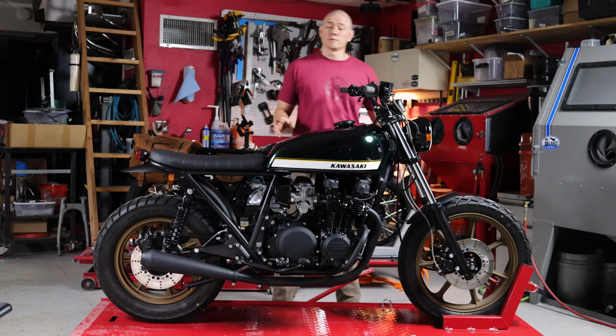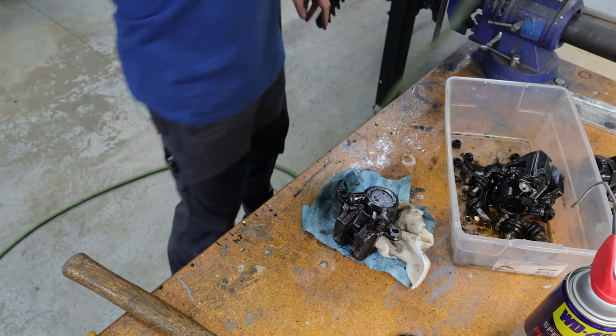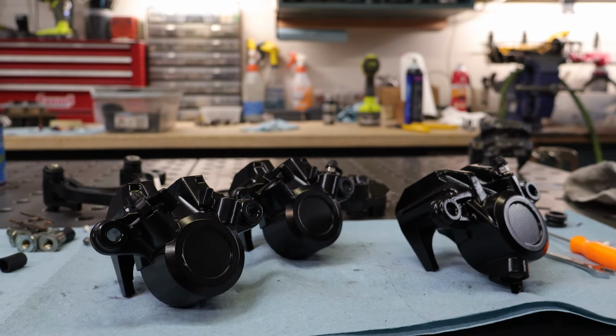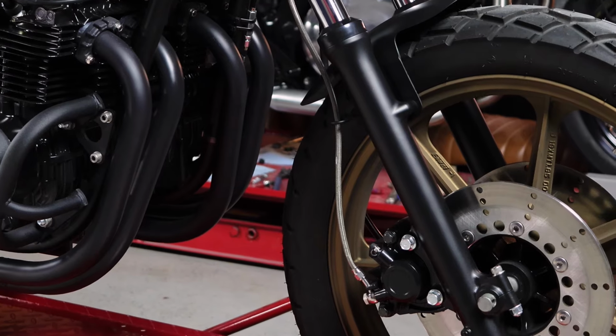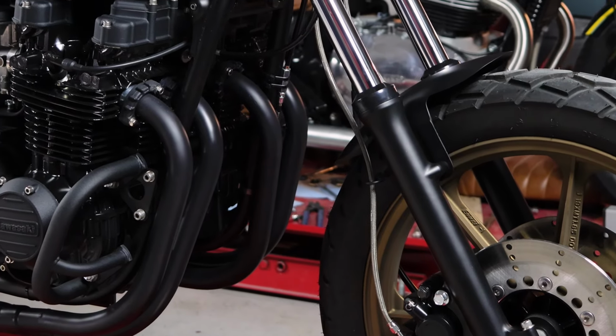The hydraulic brakes were cleaned up and powder coated and rebuilt with some kits from Brake Crafters. We actually have a video on that process that I'll link to in the description as well. We got these mounted up with new rotors, new master cylinders, and some new custom stainless steel braided brake lines.